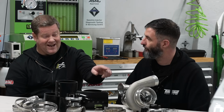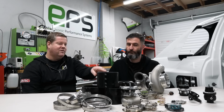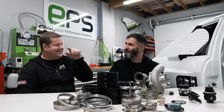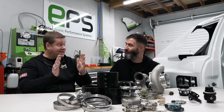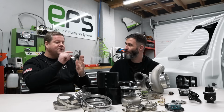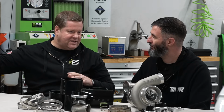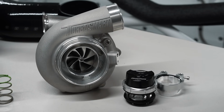And I had it once, we had a position sensor in one of the wastegates. It was a 45 mil gate and we had the boost control valve on it as well. I remember watching the diaphragm in the wastegate go. Then I spread it out in the software, and it was exactly 17 hertz frequency, the pulsing of the valve, and it lined up with each little peak. And the boost control was mint. That was in the intake manifold, but the poor little wastegate was getting shaken around, really. Literally we changed the frequency to, I think, 25 hertz or something like that, and it stopped the wastegate from playing around.